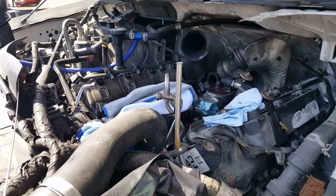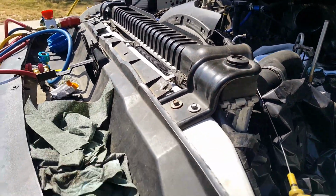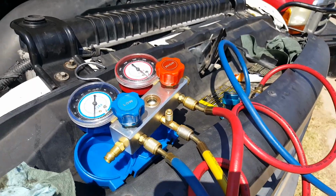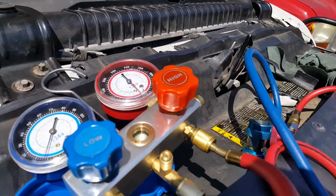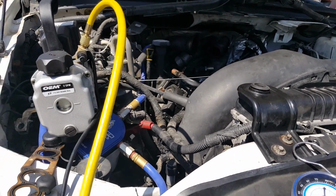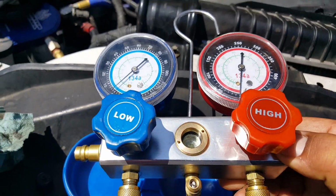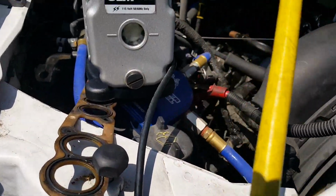Okay, we're getting closer to installing the oil cooling system. However, to install the oil cooler radiator, I'm gonna have to remove all this, and it also requires you to remove the AC condenser as per the instructions on the bulletproof method. I was hoping to have some time to maybe squeeze it in there without having to drain it, but it's just prolonging everything. I went to the local AutoZone and was able to rent out the vacuum pump with the gauges. They seem to be pretty new, for less than, I believe it was $308, which is fully refundable after I return everything back.